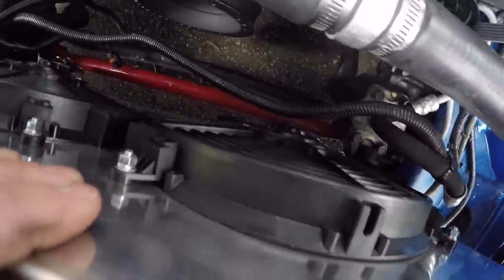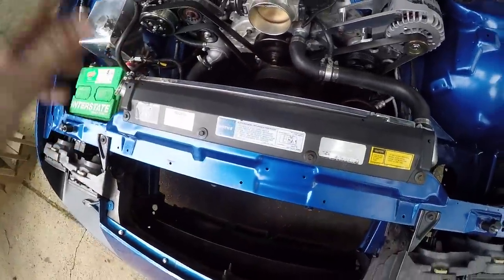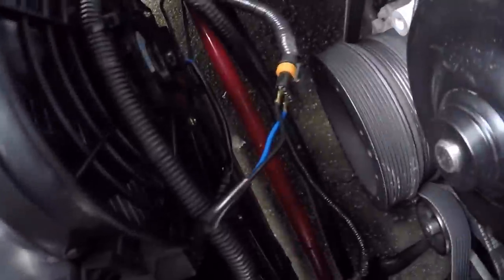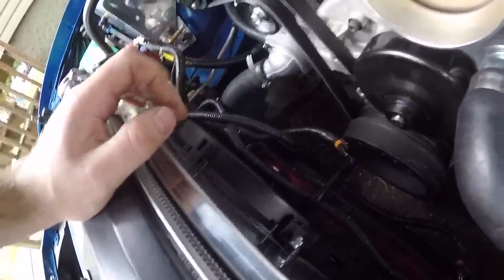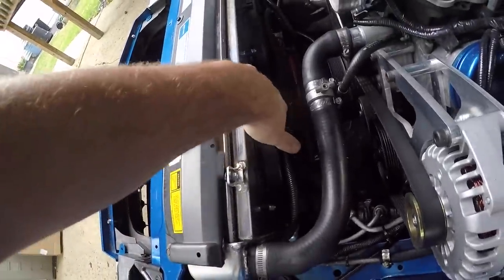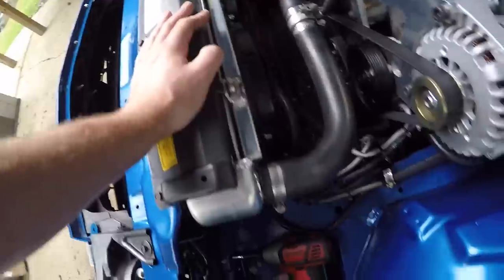You can see now I have a lot more room between the steering box and the fan. I finished putting the fans in — I slid the terminals into the original LS1 connectors. I'm probably going to cut those connectors off and put a proper fitting with heat shrink. I started the car up to test them — they're pulling air and wired correctly, but I'm noticing the temperature is going up at idle.